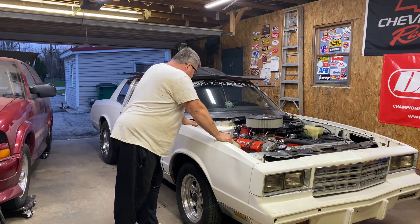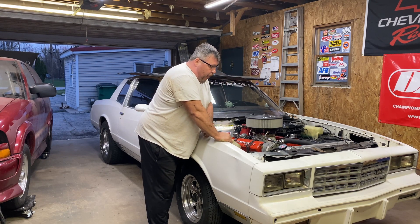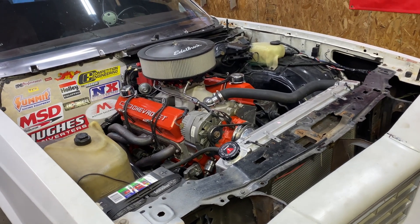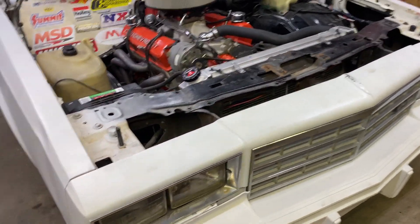He's got himself a nice car — I almost hate to put that solid roller in this setup and lose its drivability. This thing just cruises down the road with power. But we were all young once and once you go fast you always want to go faster, so that's totally up to him. I did end up getting the brackets put on the radiator; I'm still going to have him bring that shroud over. I decided to wait on draining the oil — there's no sense leaving brand new oil under the car letting bugs or dust get into it. When we've got it up in the air for the brake hose, we'll change that brass washer on the drain plug then.